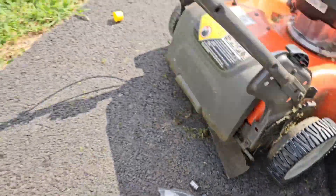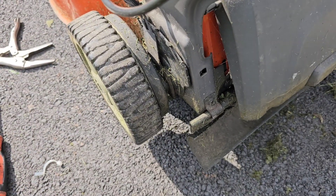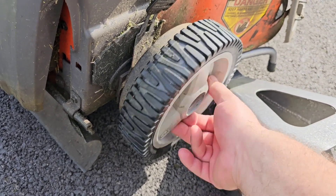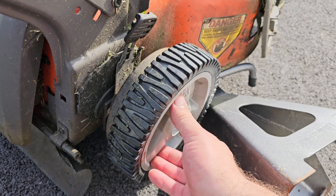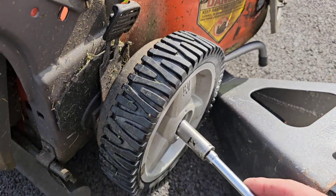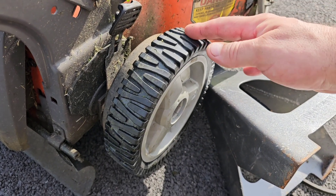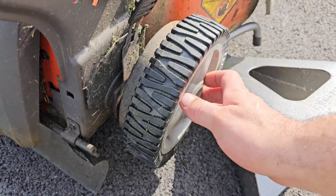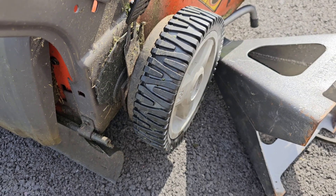I'll check the other side to see if it makes any noise — that one's good. So that's the gear. Very importantly — spin this and listen. It sounds a lot different, a lot cleaner, not grinding. I discovered the shaft that the wheel mounts on was actually bent. What I did was take an extension and a socket, put it on the shaft, and bent it back so the gears were meshing properly. Keep in mind, if you bounce this mower to clear grass, or dropped it off the back of a vehicle, it can bend these shafts. That's probably what led to the gears stripping out.